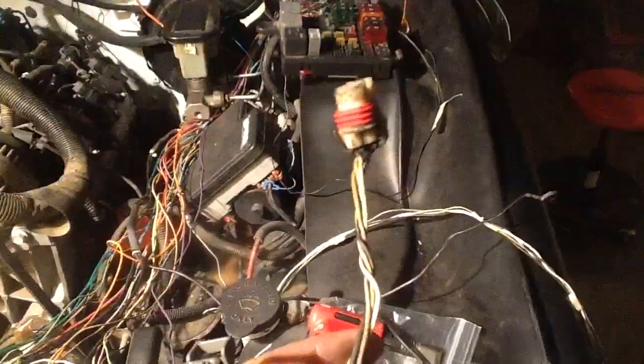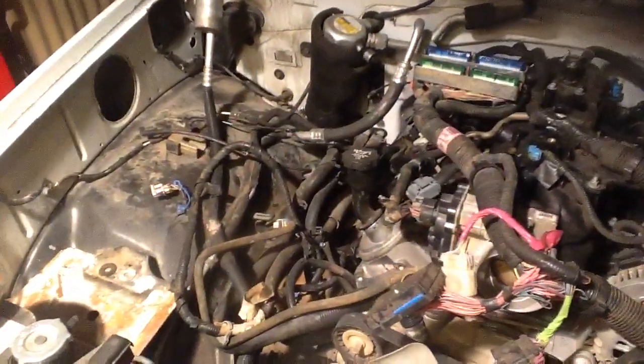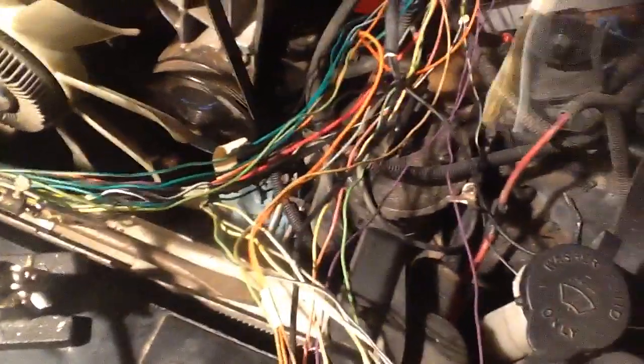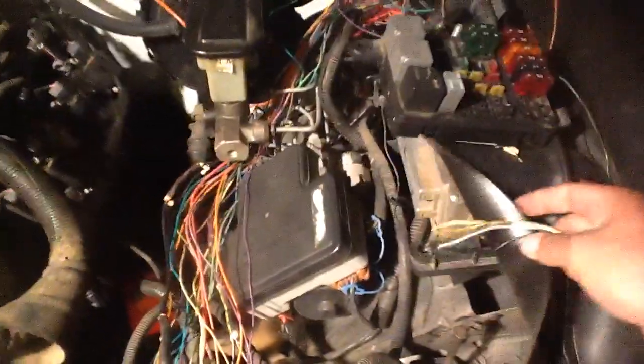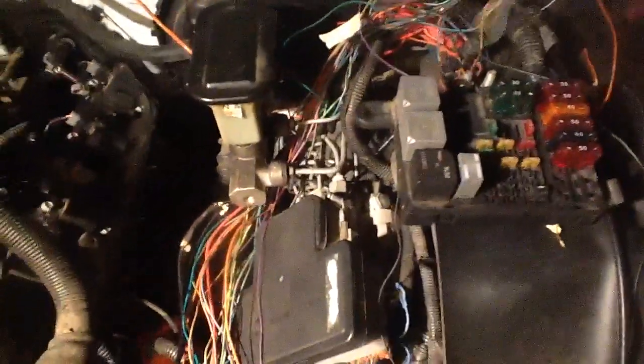I'll put the wire details in the description. But this is the one you want. I have these wires out of their loom because I was taking everything out, and I have this connector that ends up going in the firewall. The range wires end up going through the firewall over in that direction. So you're going to lose these wires once you start to loom them — they're going to get lost in this harness. So take yourself just four extension wires and tap into them here. What I'm going to do is run them right along here and get them up to this area here, because this is where I'm putting the new control module, the PCM.